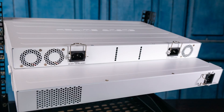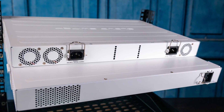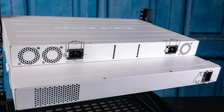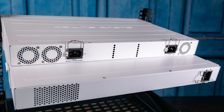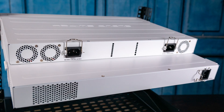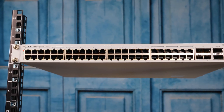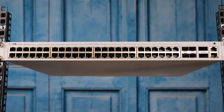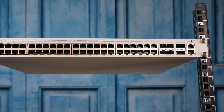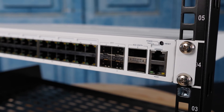Let's start from the outside and move in. When we look at the switch, you're going to notice it's about 85 millimeters — roughly 3.4 inches — deeper than the non-PoE version. So while it may look similar from the front, it's actually significantly deeper. You still see 48 ports of 1GbE on the front, and all of these are PoE+ powered ports. You can also see the four SFP+ ports plus the two QSFP+ ports.